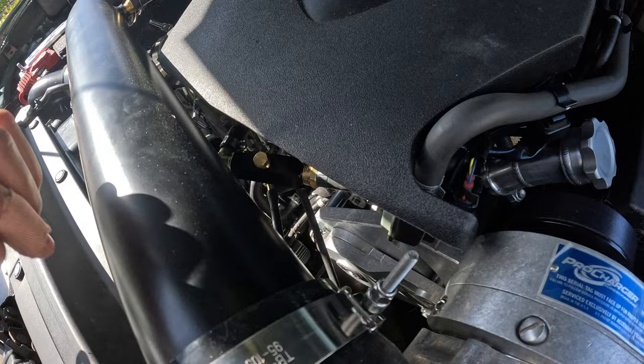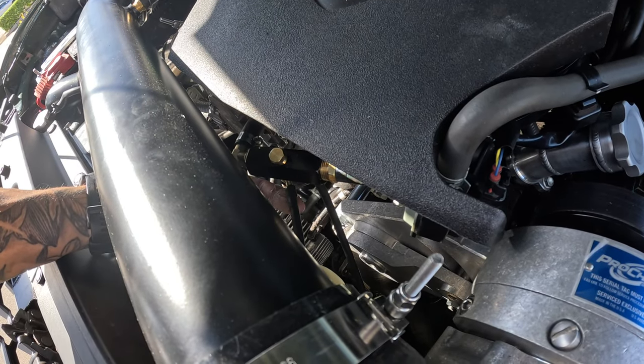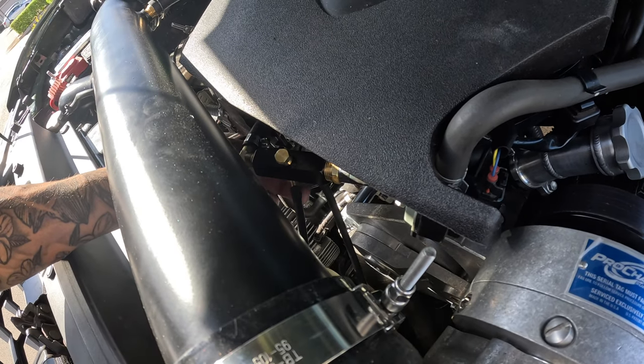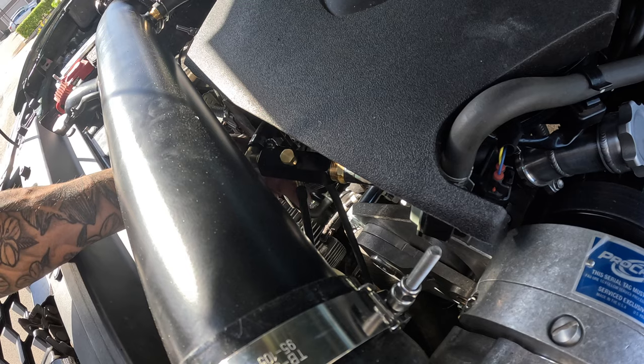For the air-fuel ratio gauge, you need to run it to your exhaust — you'll typically need an extra bung. For my URD Y-pipe there's an extra bung in front of the stock O2 sensor position, so I took out that cap and threw the sensor in there. For the boost gauge, I ran a little vacuum line to the surge valve. That port right here is the boost gauge line going in — if you're not running a boost gauge you can put a brass cap on this hole.